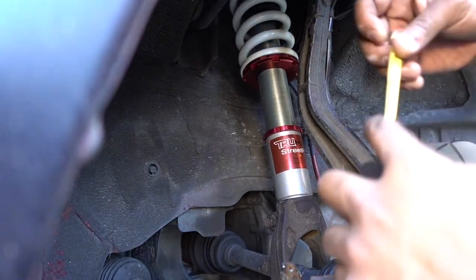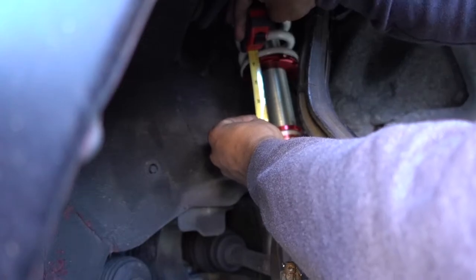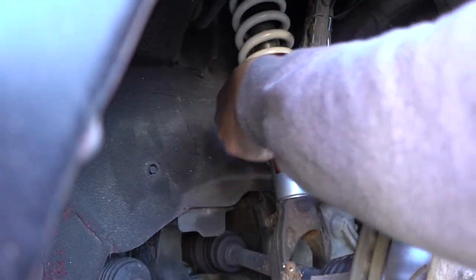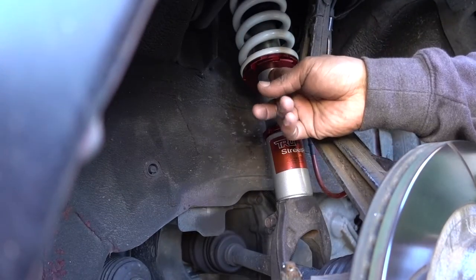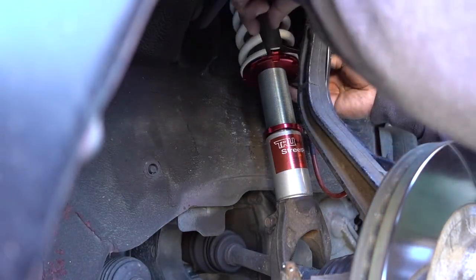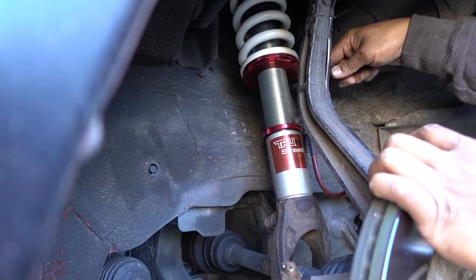Right now I'm at the same height as before. If we measure from the end of the bottom collar to the top, I have four and one quarter inches — that's how I set it up. Now I'm gonna loosen this one up, which is pretty much loose already. I'm gonna bring it up a little bit. I don't want to get the second collar on the bottom loose — what I'm gonna do is move the one on top, which moves the whole strut. That's what we're looking for to adjust the ride height.